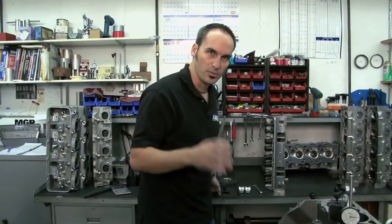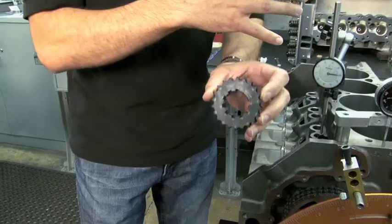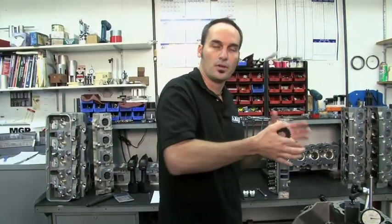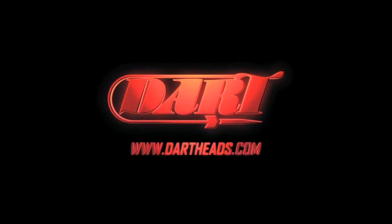Now, if that's off by a little bit, we've got different types of crank sprockets and cam sprockets, and I can make small adjustments — a degree or two degrees one direction or the other. Or maybe you want to just change characteristics of your engine. If you want to advance or retard it a little bit, you can do it the same way. So that's how you get the most out of your engine — make sure it's set up right, get it dialed in. I'll see you next time.